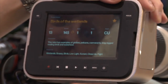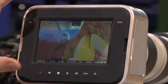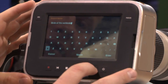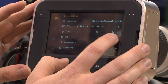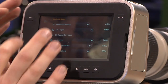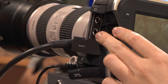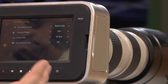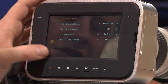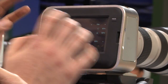The LCD is basically the only viewfinder option unless you plug in the SDI output, which is always on at 1080p. This is also how you control your settings — it's an 800 by 480 single-point touch screen. Here you can adjust all your slate metadata, change ISO settings (native 800 ISO, but also 400 or 1600), basic white balance, shutter angle, and audio controls. It has a mic in the front for reference audio, plus two quarter-inch balanced audio jacks on the side.